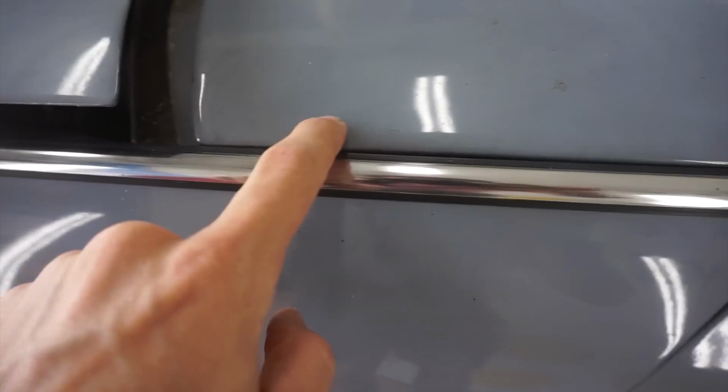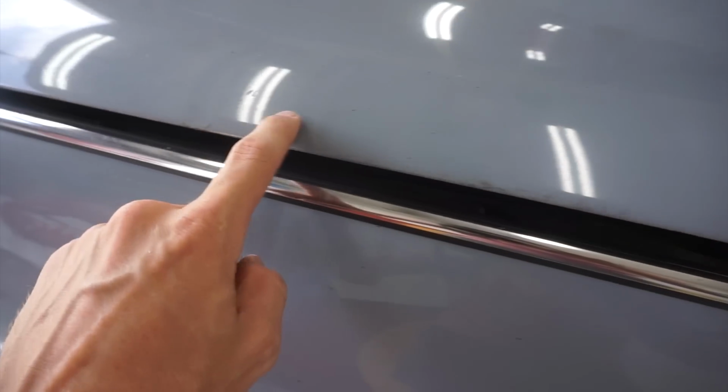And also you scroll up here and you notice some cracks and stuff. So I think this actually has body filler on it. And moving over to the hood, you can notice some cracks. Also, if you look closely, I don't know if the camera's gonna pick it up, but I can see swirl marks from where a DA was sanding. So maybe this has some body filler on it.